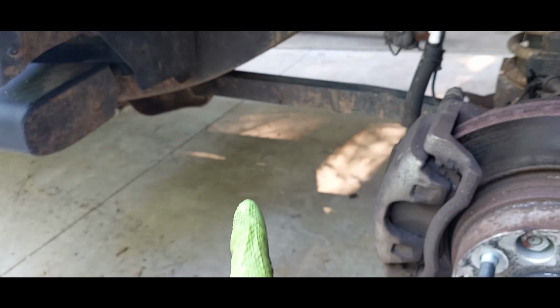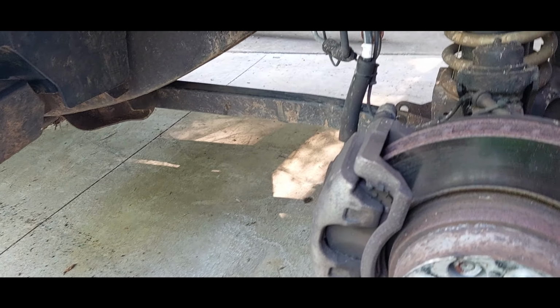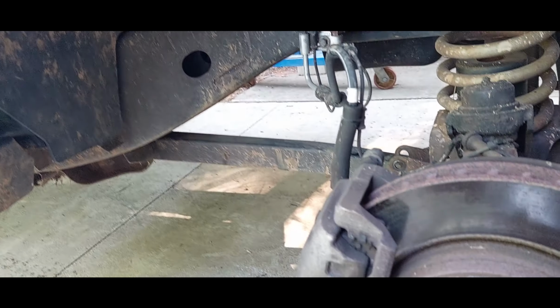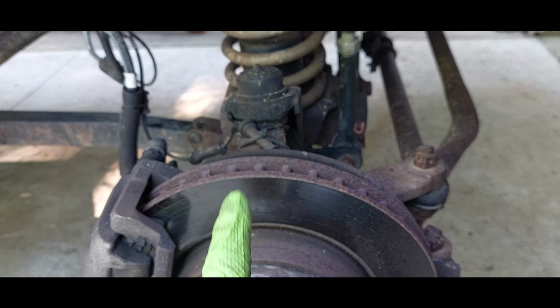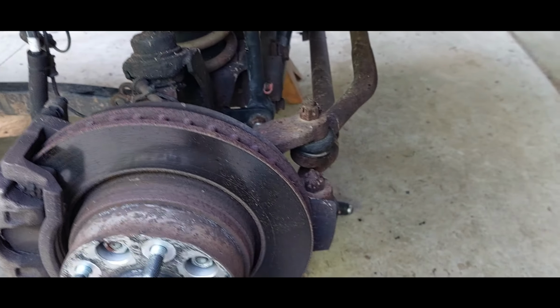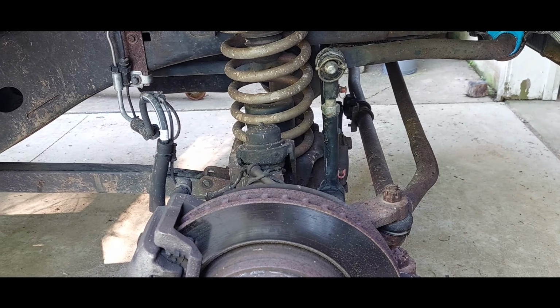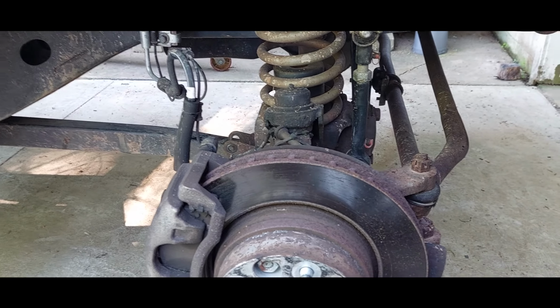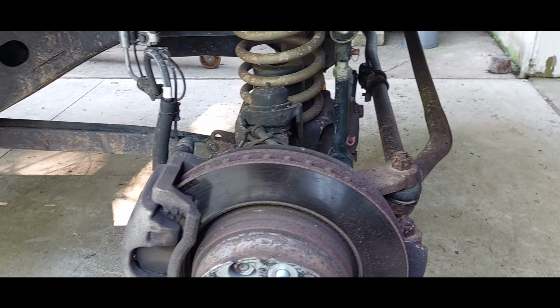Let's see, I got to move over here. I got to loosen both control arms so they're kind of flibbity flobbity, and then get the bracket in. And let's see, I'll do brake clean and lubrication and chassis grease once I get both sides done. That'll be last. I'll get everything else in and done first. I don't want to be fighting that stuff. I just don't want to grease it up now. You always get a little bit of grease squeezing out, and then you got to lay in it or goop in it or something. So back to work.